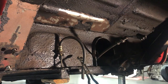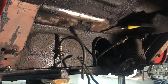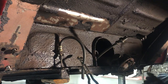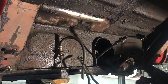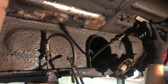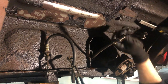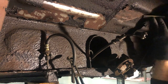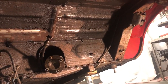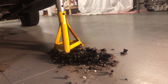The other option is with a chisel like this — actually a wood chisel — which I've found quite good on flat surfaces. The alternative is dry ice blasting. This patch here was done in a very short period of time with a dry ice blaster, and the great thing about that is it means I don't need to take the fuel tank out and worry about the fuel pipe, which is obviously much more of a concern if I'm using an angle grinder. Let's see what it looks like with a chisel. Oh, that's really thick stuff, but it's actually coming off really quite well and easily.